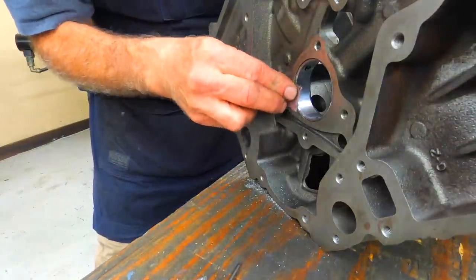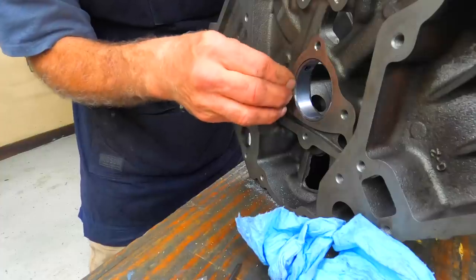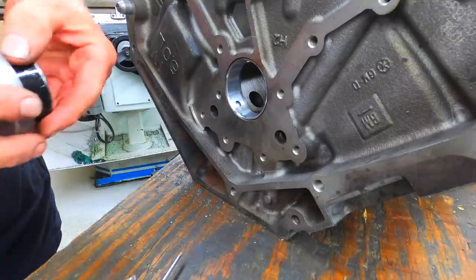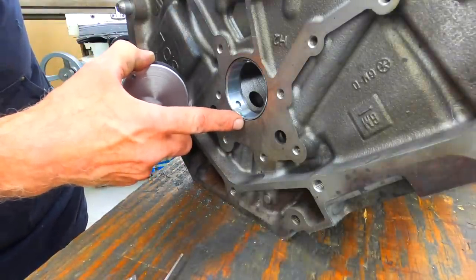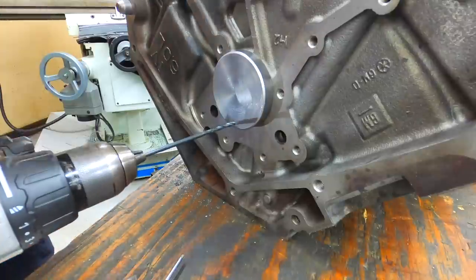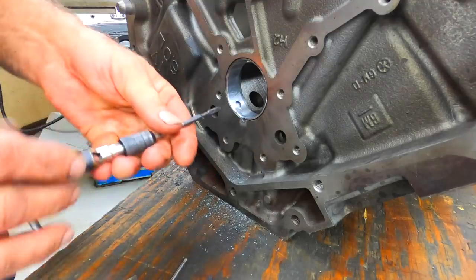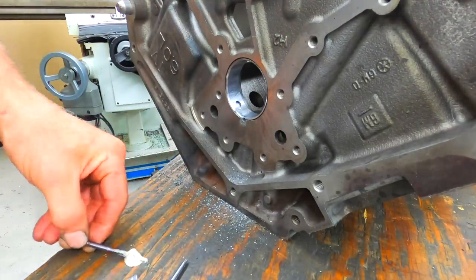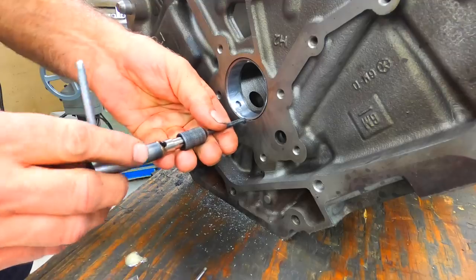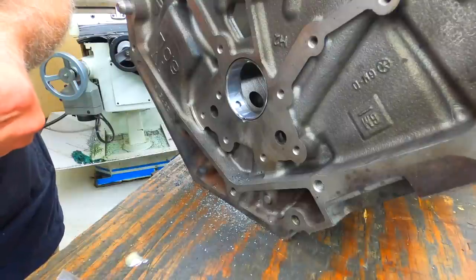Usually take a little piece of emery and just knock off any burrs. Do the rear one the same way — I usually try to do it somewhere up in the top; there's really nothing in the way up there that's going to cause an issue. Flip it in, start with your taper tap, then set screw with a little Loctite.